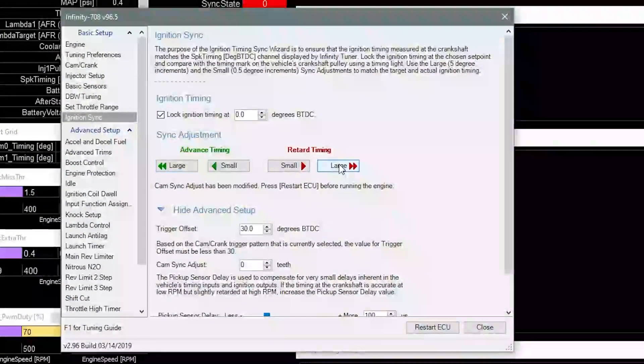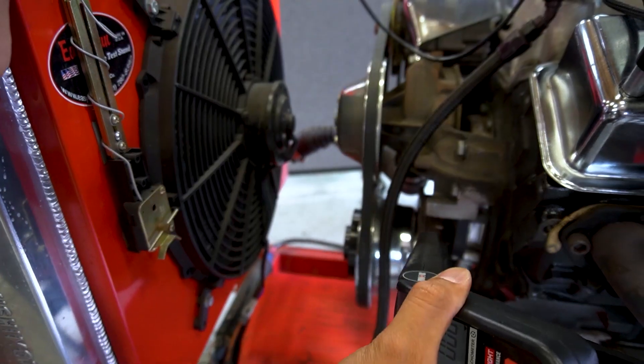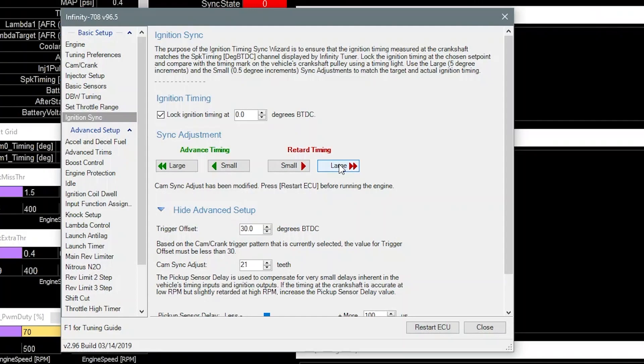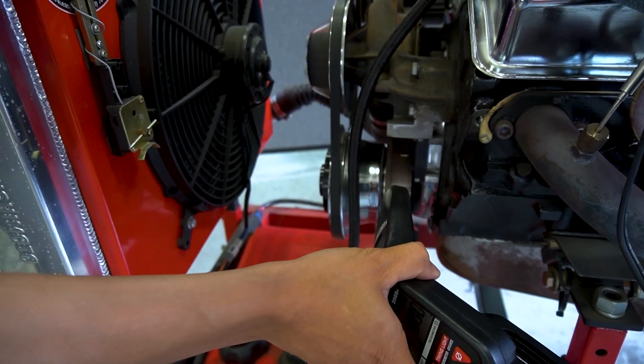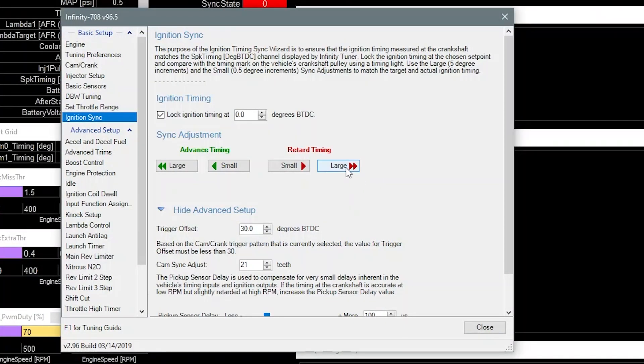In our last test I was actually able to see the mark we made 90 degrees advanced from TDC. So we retarded our timing 90 degrees by clicking the large retard button 18 times. After cranking again, I saw the light flash with the indicator somewhere between 10 and 20 degrees — around 15 — so we retarded the timing another 15 degrees to get close to zero. After one more check it was firing at about five degrees, so we retarded another five degrees and that should be close enough to start the engine.